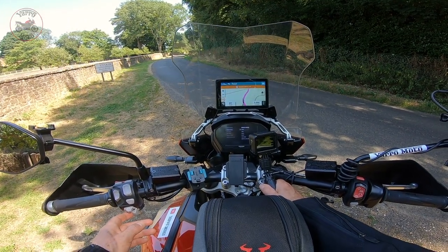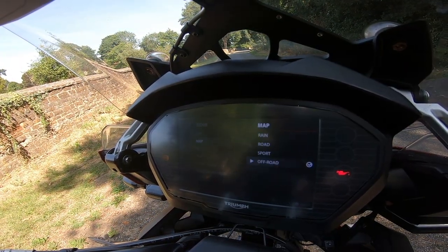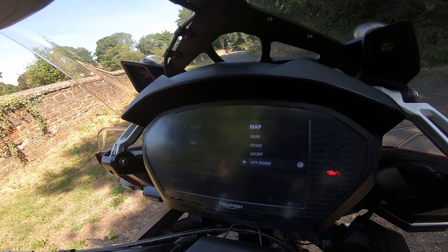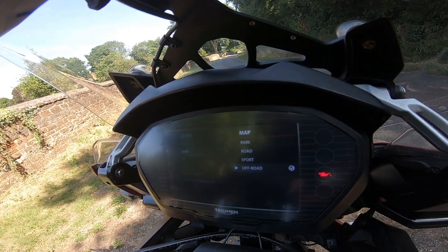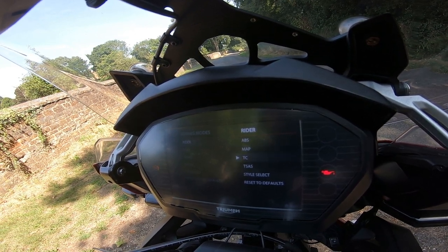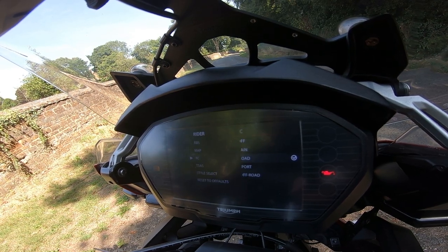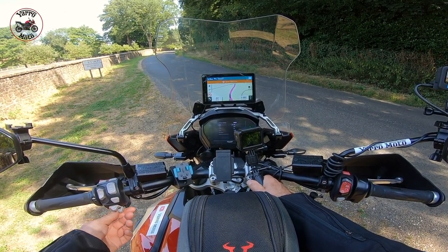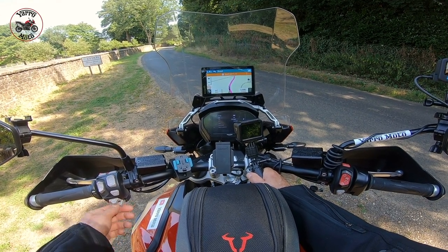Under your own pre-selected rider settings, go down to map and make sure you've chosen off-road as I have here — that's ticked. Go back to the rider stage and go down to traction control and ensure that that has been switched on, because the off-road default is traction control off. Also go into ABS and make sure you put it into road mode so that it's switched on.